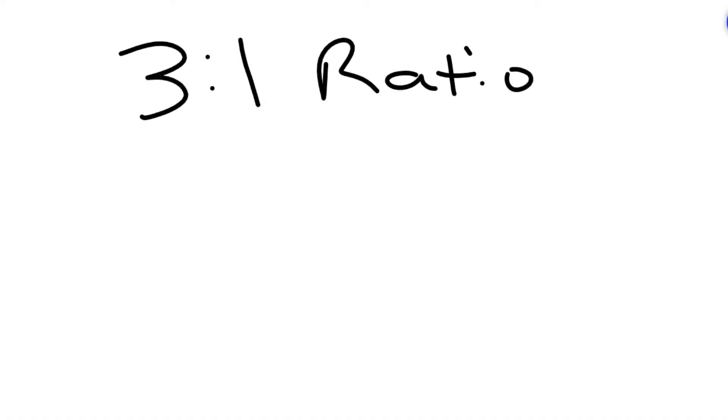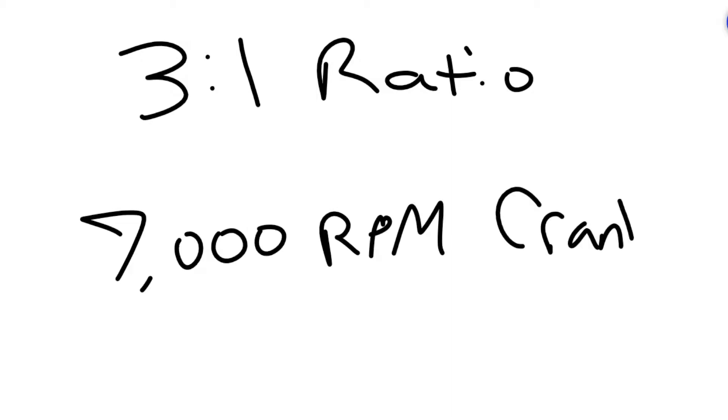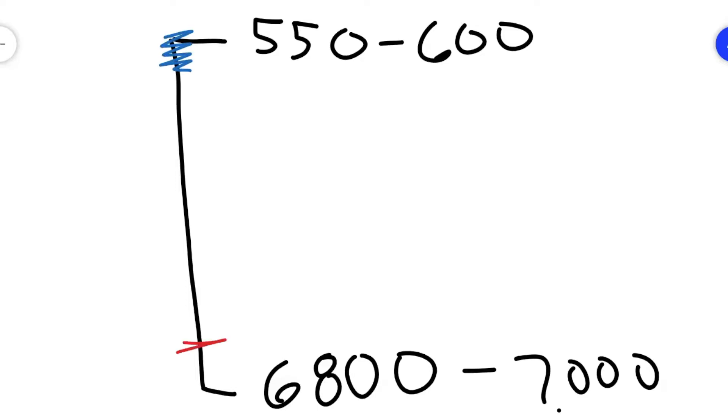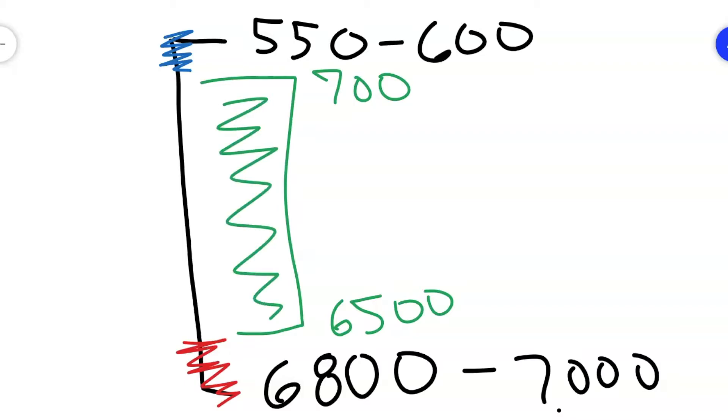At a 3-to-1 ratio from my crank to the alternator pulley, I'm revving to maybe 6,800 or 7,000 RPM. Multiply that times 3 and you're talking 21,000 revolutions per minute on the alternator, which is obviously higher than the 18,000 it can handle. So we're going to go to my tuner and make sure my redline is set to around 6,500 to 6,800. We had it up there to get a little extra pull out of each gear, but if it's just going to cause problems I'm willing to tune it back. We're also going to raise the idle RPM by 100 and see how it handles.